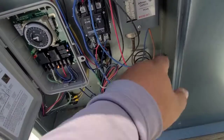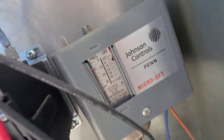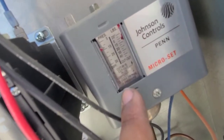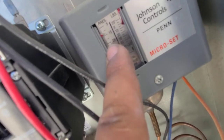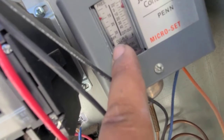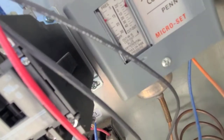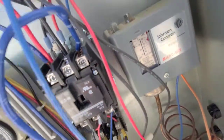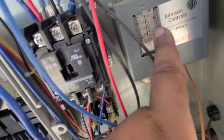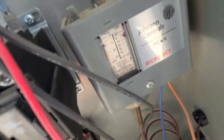Of course you got the contactor that pushes in and your low pressure switch, and that's set up — cut in, cut out, plus differential. So that's set up at 15 psi cut-in, and it's cut out set up to about 5, 4 psi. Once it hits 5, 4 psi, it'll shut off so it doesn't go into a vacuum. I'll round it up to 5 — 5 plus 15 — so at 20 psi is when it cuts back on.